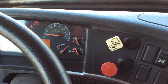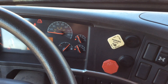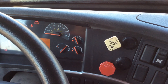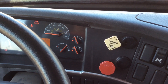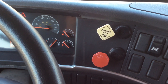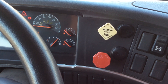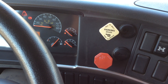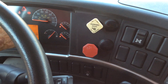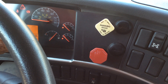For the automatic spring brake test: your trailer brake should come out before your tractor brake, and it should come on between 40 and 20 PSI. Fan your brakes again — that's a good test. Do a safe start: clutch in and shifter in neutral, then check again that your ABS lights come on and off.